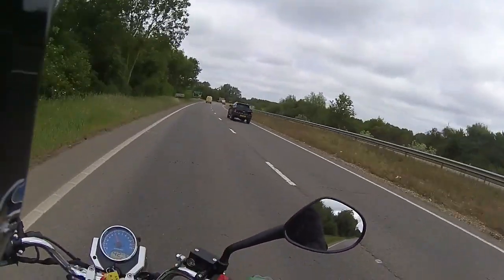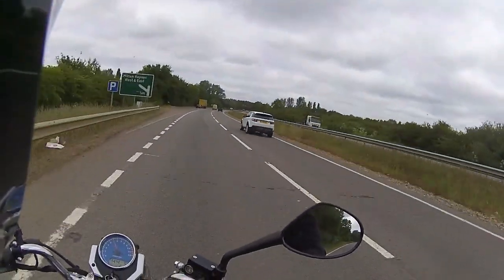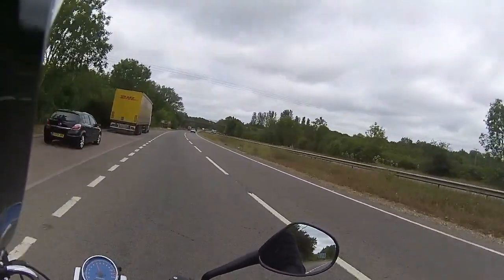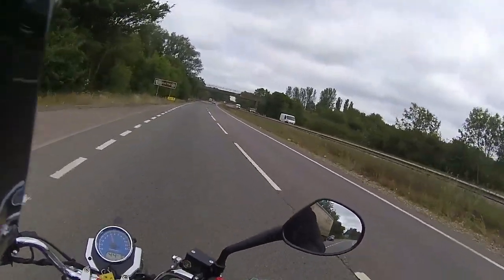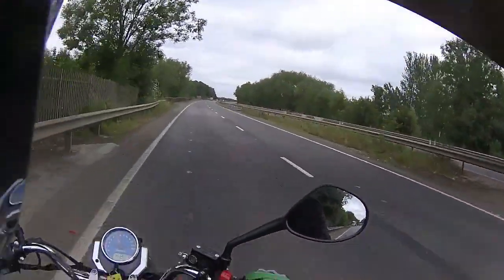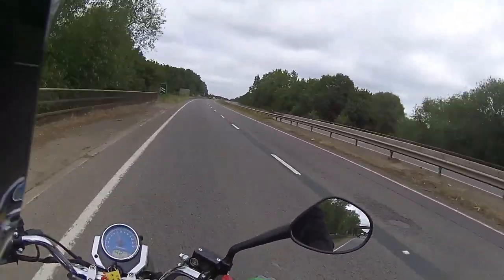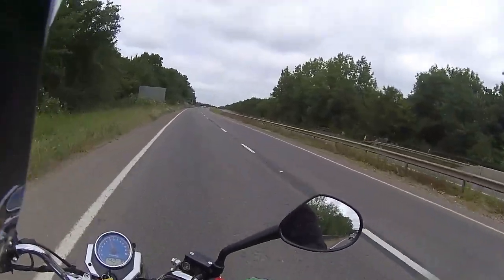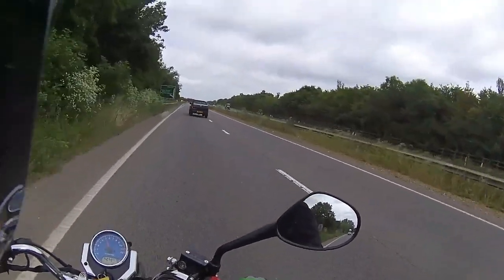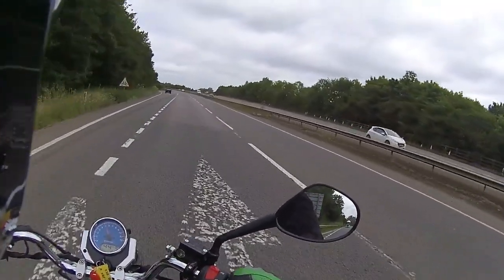Sitting at a nice steady 5,000 RPM. On a new bike, try not to go above 5,000 RPM between gear changes — don't race the engine. These start redlining at 10,000, but I wouldn't expect anybody to take it up to 10,000 even after running in. Keep your revs nice and low, get it up into top gear as quick as you can, then vary your speed using the throttle. There's quite a headwind coming in now as the weather closes in. Ten miles in — absolutely zero issues. This little ZSB is doing the job, halfway through.